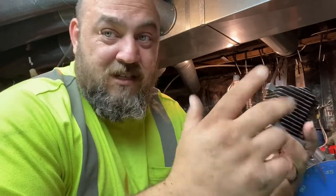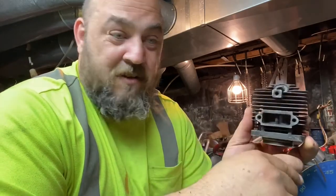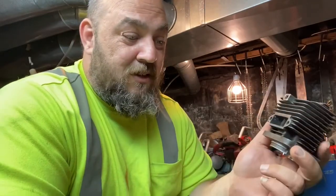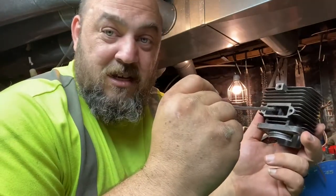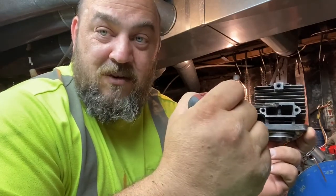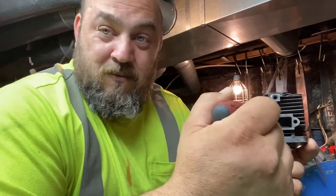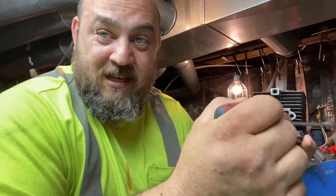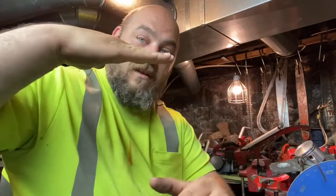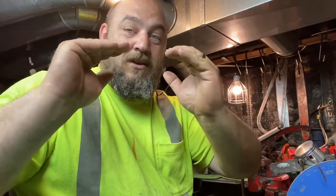And the square exhaust shape, you can do things to change that to help improve power. But believe it or not, the square exhaust shapes are actually some of the better performing shapes. So you can round them. If you grind it up and round it off, it helps get it flowing just a little sooner to give you a little bit more RPM. But if you round it off, it helps maintain some of that torque through the cycle. The most common method is to have the top flat in the center and then curl the edges. That's probably the most common shape for a performance two-stroke engine.